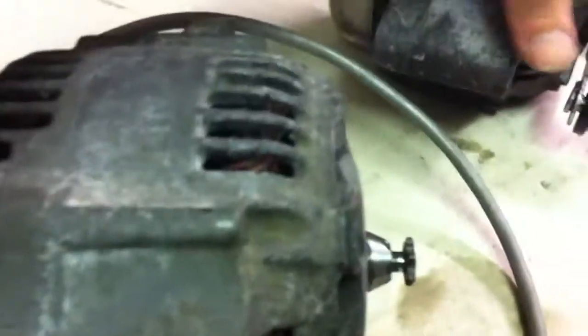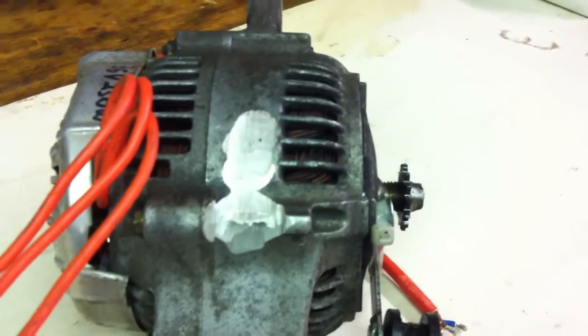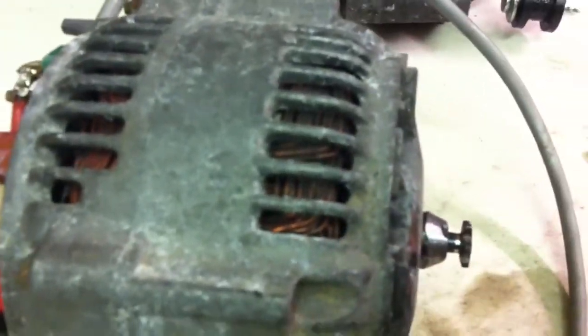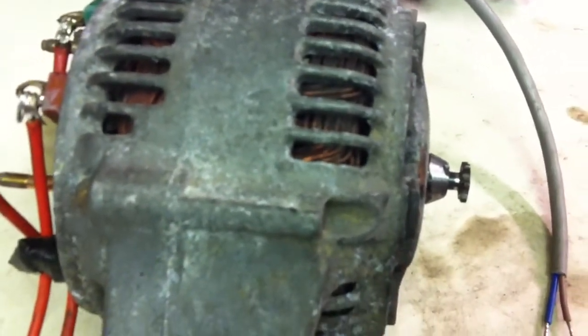The pinion clearance away from the body is exactly the same to within half a millimetre, so it should just be a straight swap. Since I've taken this extra chamfer out, I'll bolt it straight up — that's tomorrow's job because it's late. Ciao for now, bye bye.